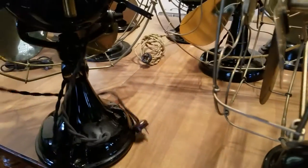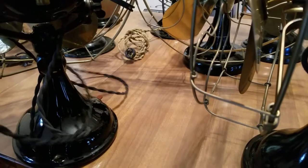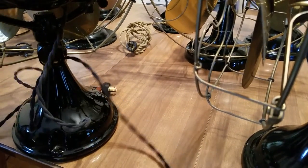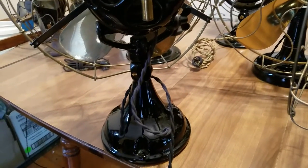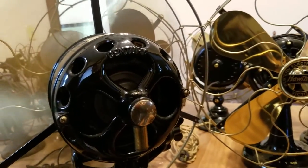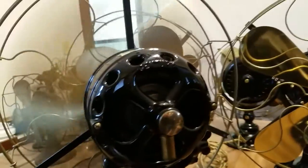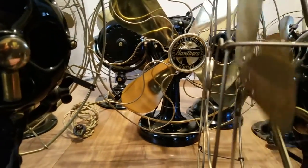This one they call a skeletal motor. This one - there's only four of these that exist. Let me plug it in. This one's got a pretty cool motor. This is a 16-inch fan, so it's a little bigger, but there's only about 12 of the 12-inch fans and only four of these that exist. Who made these fans? This is a Sentry - Sentry made a lot of ceiling fans too. This one has a centrifugal switch too, if you see that thing in there, and you'll actually hear it when I turn it on. Listen - wow. See how it snaps like that? That's the switch opening up. These ones are really cool because of how open the motor is - it has these huge open vent holes. That was for cooling - vent holes in there for the air to pass through.